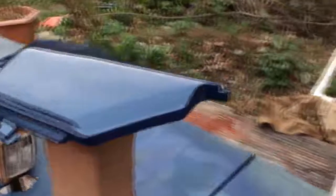Okay, I don't know if you can see there, that's the first coat gone on. Don't worry too much about it being excellent coverage. All we're looking at there is getting the first coat on so that the rest will stick and apply to it. I've done these other bits as well. These have got a thin coat on too. You probably can't see that, but one coat is all you need, a thin coat. You're not looking for a wet coat at all, and that's where we're at the moment. So I'm going to let that flash off under the heat lamp, and then we'll come back to that.